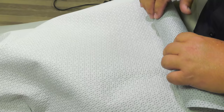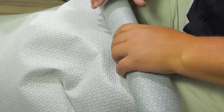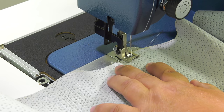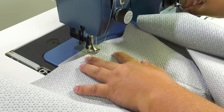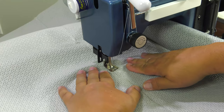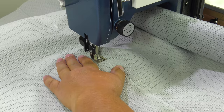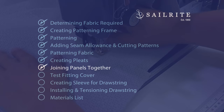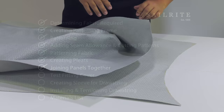We're scrolling up the material to fit it under the arm of the sewing machine. This is the location of the headlight — we had excess material, and these two pleats will remove the excess, making a better fit. When we finish this top stitch, there's a pleat directly across from this one — we'll go to the end and move the material without cutting threads to the next pleat, make sure the tail is folded back towards the top of the cover, do some reversing, and sew through to the opposite side. Now that all our pleats are complete, we just need to sew panels together.